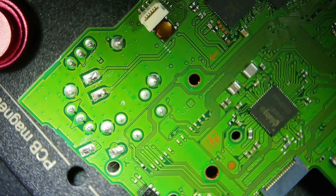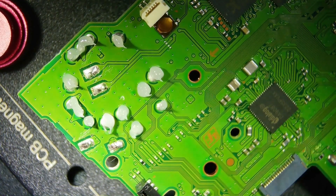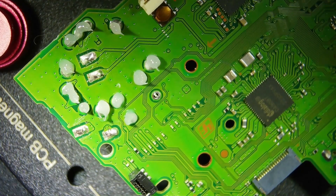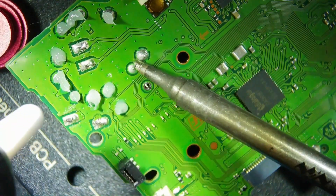There are many ways of doing this. First of all, I'm going to try it with a solder sucker and see how I get on, because I really want to improve my skill with it. We're going to go in with this one first - melt it, get the solder sucker in there. Around this time I decided I was going to go through all the pins and touch them up with leaded solder. What this does is lower the melting temperature of the factory solder to somewhere in between leaded and unleaded solder, so basically it's going to melt a lot quicker and come up a lot easier.